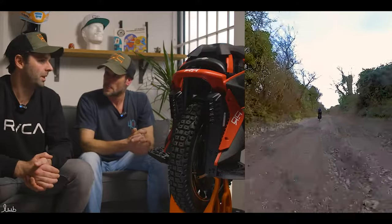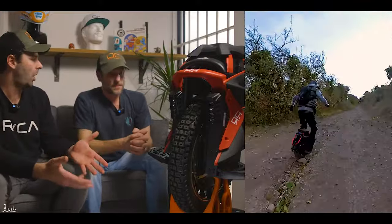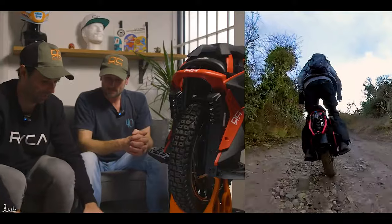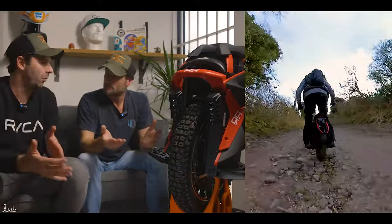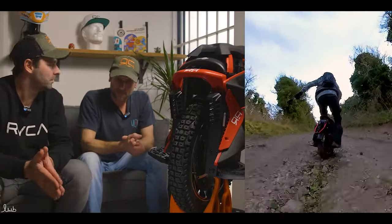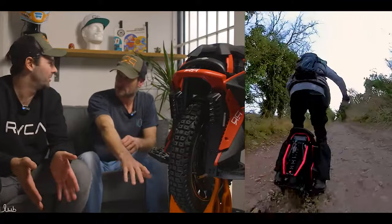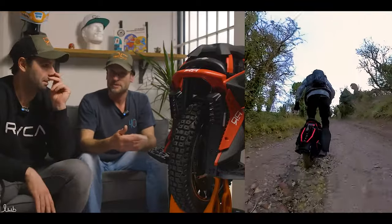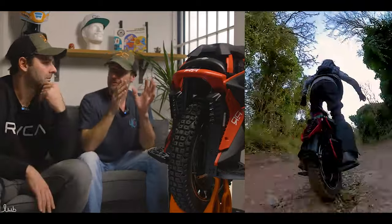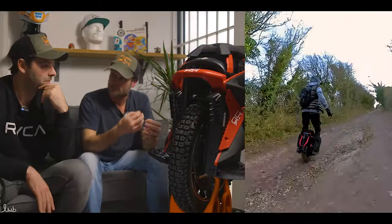From my point of view looking at EUCs, this looks like quite a high wheel — you're quite high up on it. Obviously the clearance needs to be high. But does that make it top heavy? Small wheels have a low axle and they're inherently stable — they almost self-stabilize with a little gyroscopic effect. We always want inherent stability to come from a low centre of gravity. But if it's too stable, you lose your feedback and authority. So you can look at it two ways: it's really stable at low and high speed, but that doesn't give you agility — you don't get the feedback.